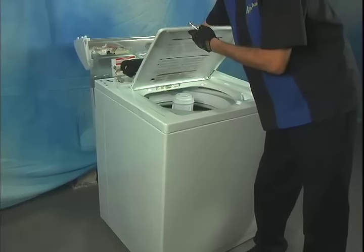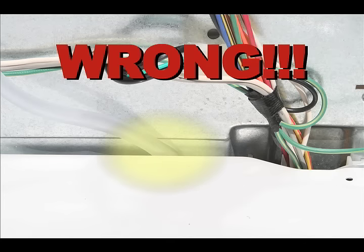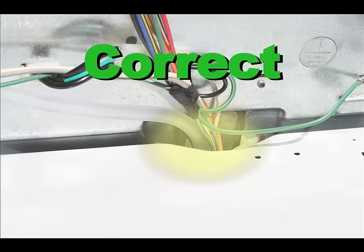Tip the cabinet back. You may need to squeeze the back sides of the cabinet inward to ensure that the rear frame pins insert into the rear of the cabinet holes. It's also very important that the small hose that attaches the pressure switch is not being kinked by the cabinet, or you may get an overflowing washing machine. Reattach your cabinet clips by inserting them into the back panel of the washer and pushing them down with the palm of your hand.